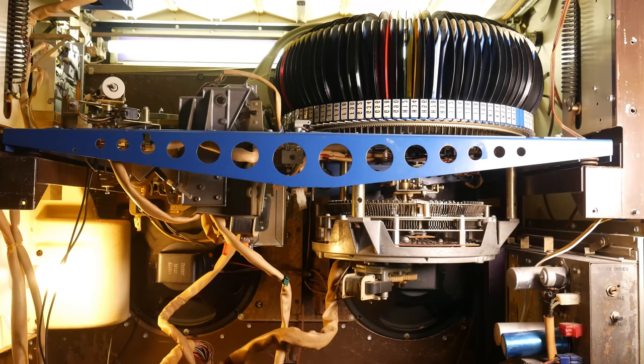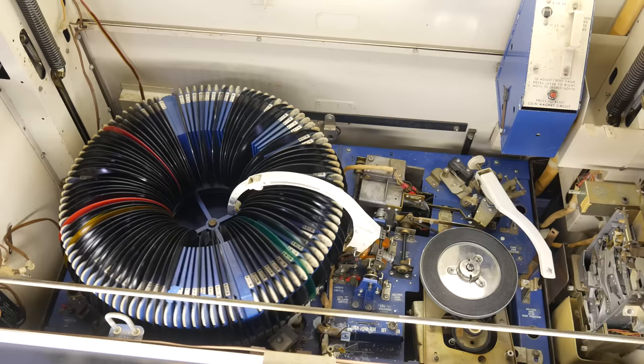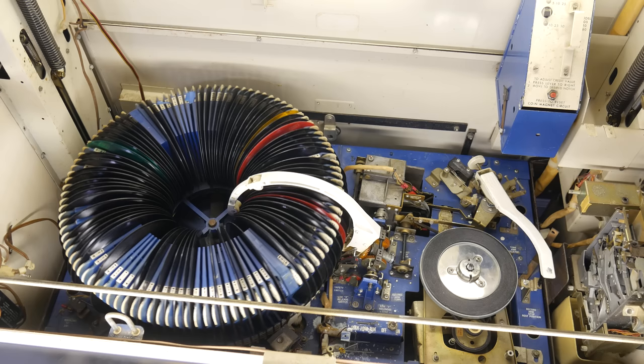And when that switch is closed, the record changer has gone from its first to second of three modes. There are only three things the record changer can do: nothing, so standby, scanning, and then playing. So that power switch kicked us out of standby and put us into scan mode. Now that we are in scan mode, we will finally piece together what the heck is the purpose of all those pins, and why the selection accumulator is even there.